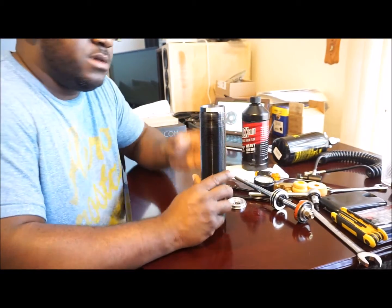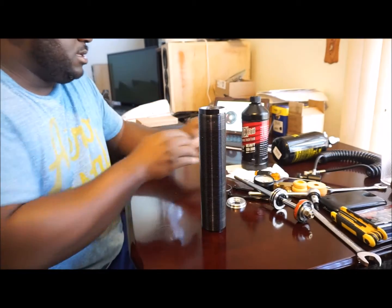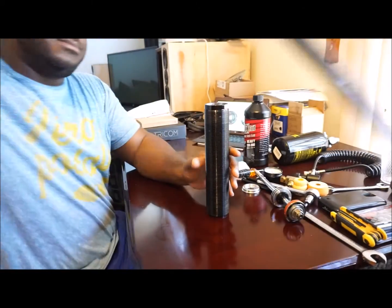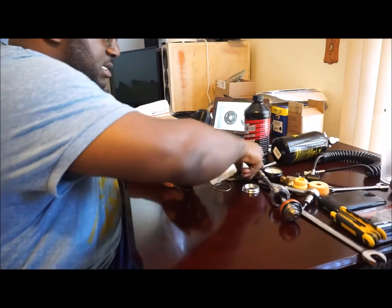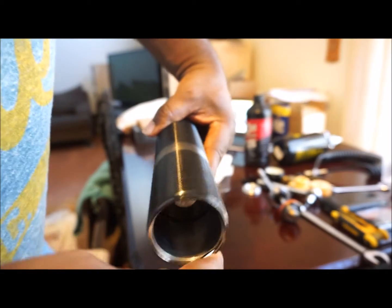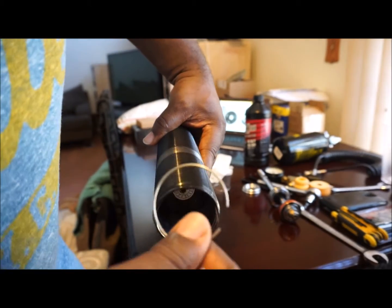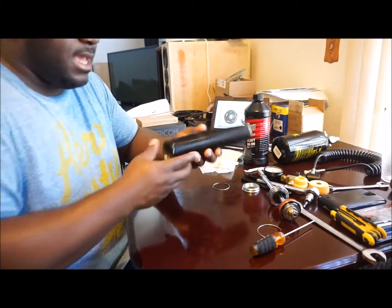I've poured all the shock fluid back into its case. If you can see inside, that's the dividing piston, and that's the butt plate. I'm going to use a broken broom stick to push it out. Actually, I'll remove the c-clip on the bottom first so you can see what it looks like — here is the c-clip. This is a steel body so I'm not too worried about screwdrivers scratching the inside.